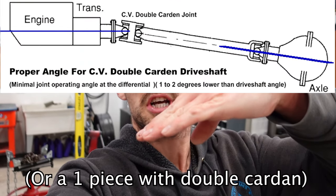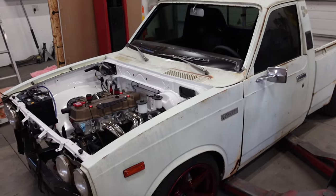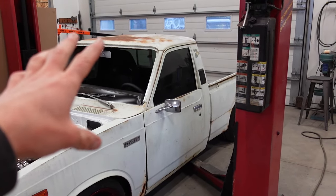When you have a double cardan joint on the rear of a two-piece shaft, you want to pitch up the axle to be in line with the driveshaft — basically at close to zero, maybe one or two degrees just to keep the u-joint moving. The double cardan joint is basically two joints in one, and it cancels itself out. If you have five degrees on one joint and five degrees on the other, they cancel each other out to zero. So with a double cardan joint, you point the pinion up at the cardan joint and don't add extra angle on a third joint, or you will get vibration.